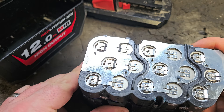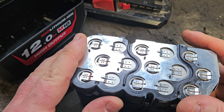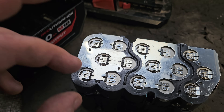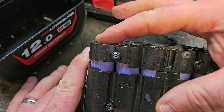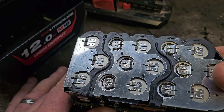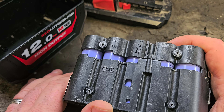The main change of the Forged battery compared to this old High Output one is the cells. We hear so much about tabless cells — these old Samsung ones are not tabless, but they're 21700s. The new ones are physically the same size but they are tabless and a different brand. The tabless cell design lowers the resistance within the pack, and in theory this should help with the balancing issue.